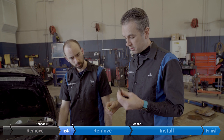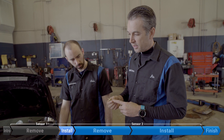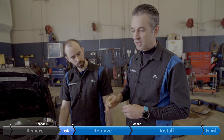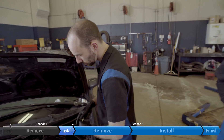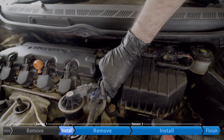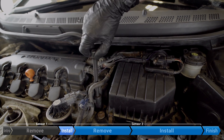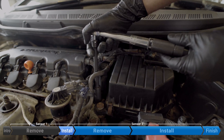Here's the old part and the new part with the brand new O-ring. It is worth noting that the coolant temperature sensor on the top of the engine and on the bottom of the radiator is the same part. We'll just thread this in by hand and torque to 8.7 foot-pounds or 104 inch-pounds.